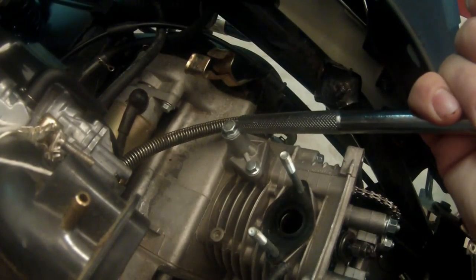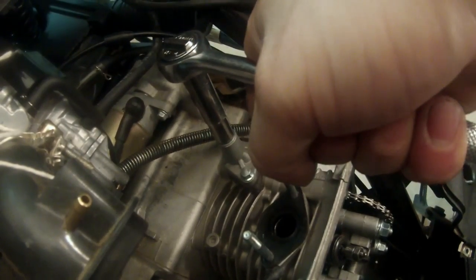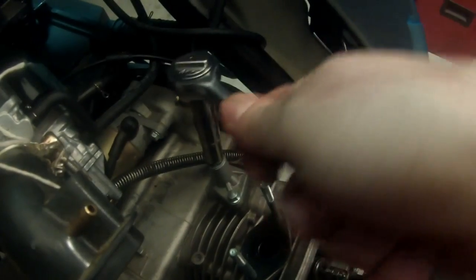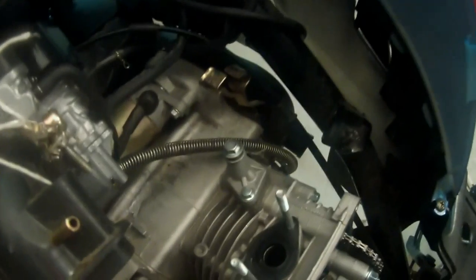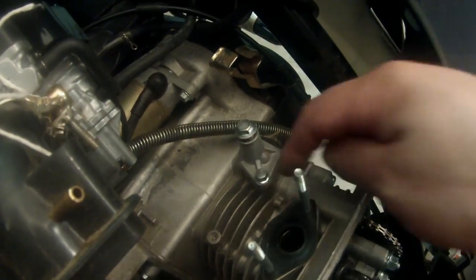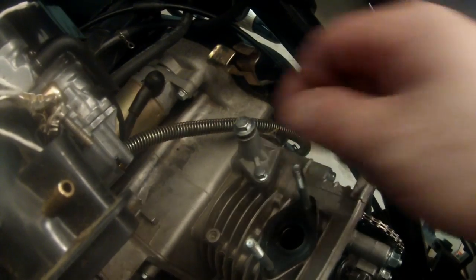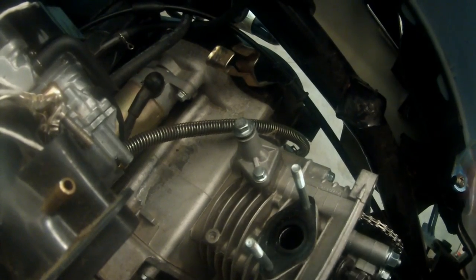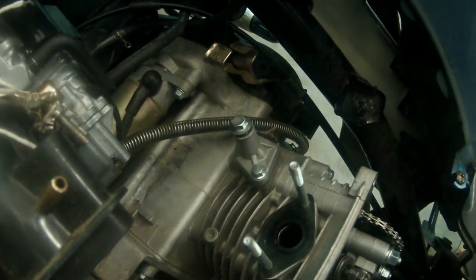Right, so right here we have our spring tensioner. You can do this at any point, but I just like to get it out of the way and get it done. So we want to crack that bolt. And cracked it has. All right, so here's why I'm doing that. All you have to do is take off these two bolts, and then your tension is released. But if you wait to crack this bolt until it's already off of the motor, then it's very hard to hold that tiny piece and crack something that's pretty tight from the factory. So I like to crack it right away.